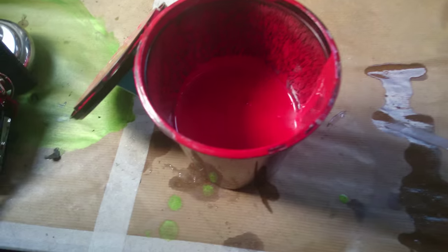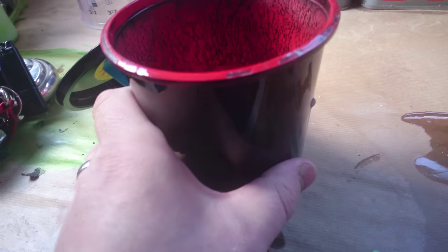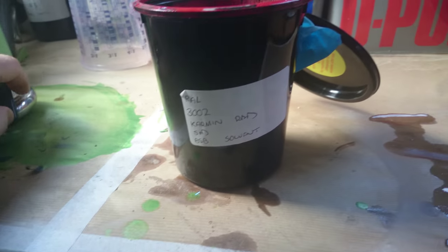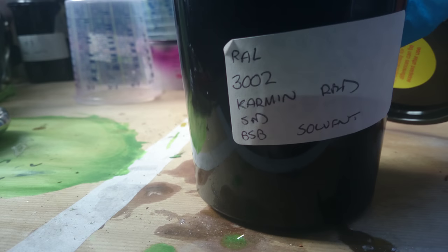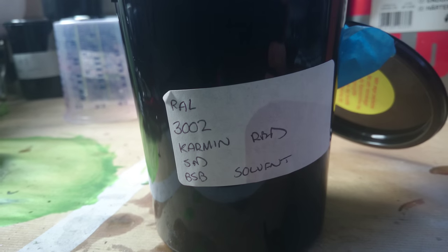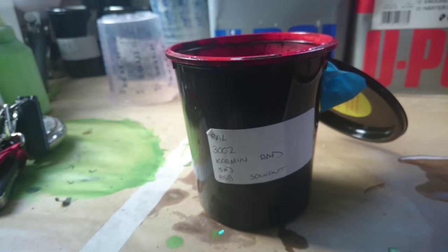The base colour for the red is here. The actual colour for Royal Engineers is a Pantone colour, but they had problems at the paint shop mixing that. The closest colour we've found - he's written Carmen Red here - it's actually 'Carmen Rouge', as it'll appear on your chips. It's a Renault industrial paint for their trucks. We'll get the paint on later and then get a coat of lacquer, get it masked off for the stripes, and then get the decals done.